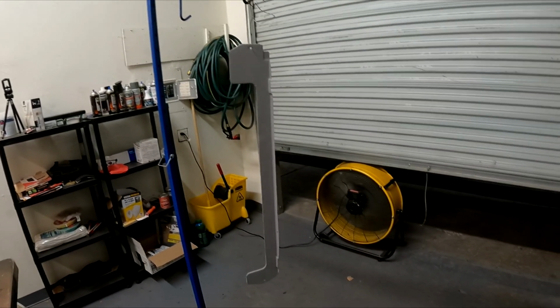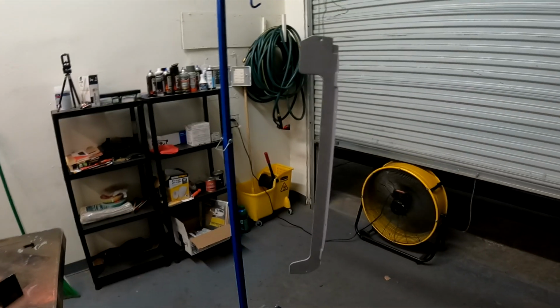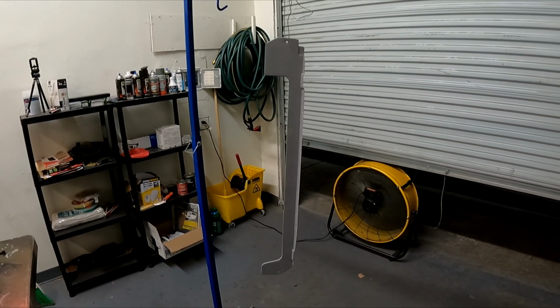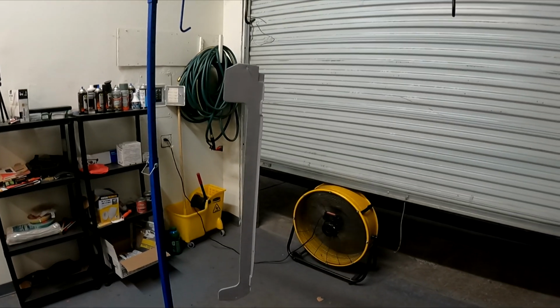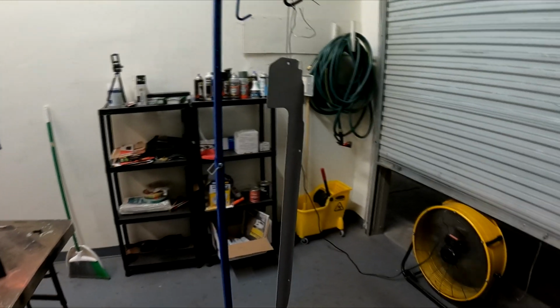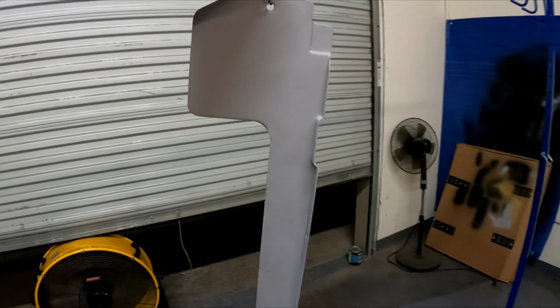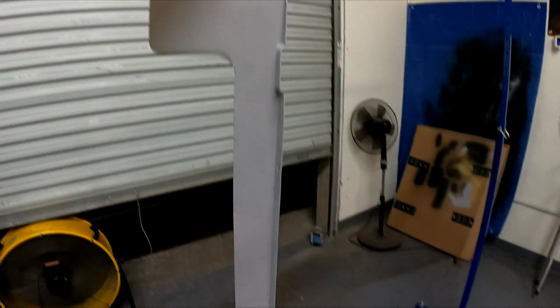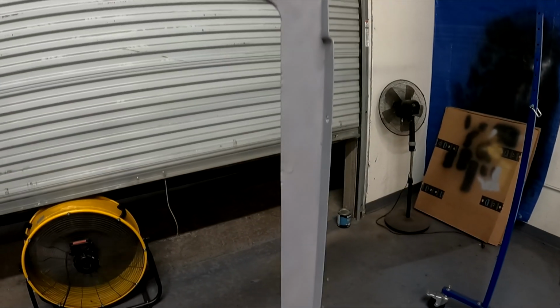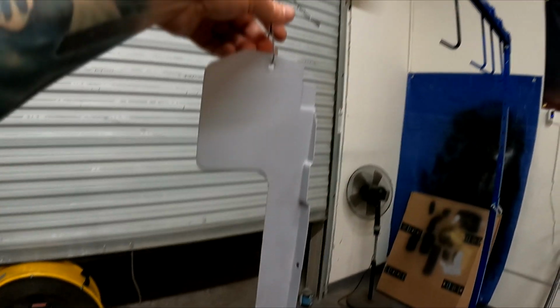We'll see. If I build up the gumption to do the filler again, then maybe I will, but I just really don't want to. So yeah, I just went ahead and basically used up the rest of my filler primer can. I basically just went real heavy with it and sprayed it on and purposely overbuilt it and let it cause a sag or two here and there just to fill it in more than necessary.